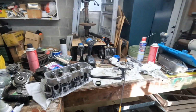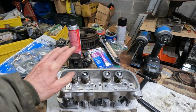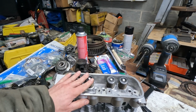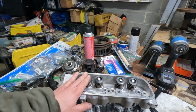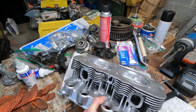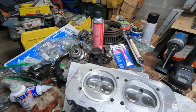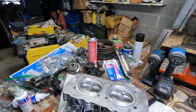Hello. We are back again. It's a new day. Ben and Romas are working on taking apart these new heads. We would like to disassemble the existing springs from the retaining clips and release the valves to check on the seat condition of the valves. We already pulled one off and it looked okay, but we want to at least check 1 or 2 more to assess if they've been lapped already as well.